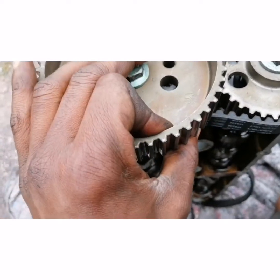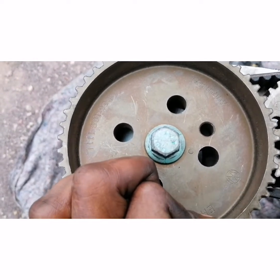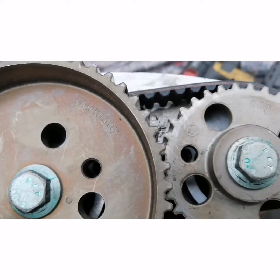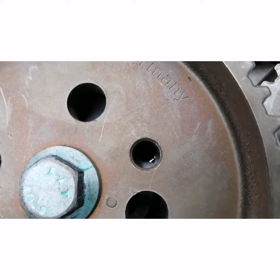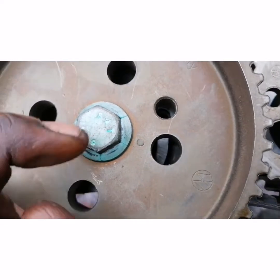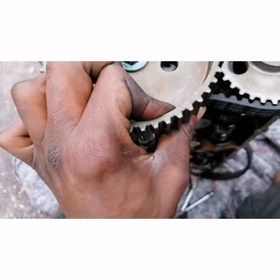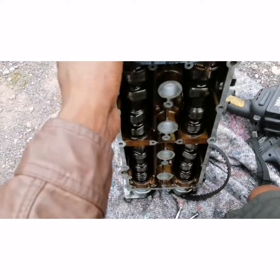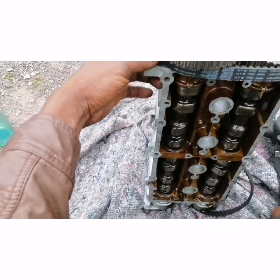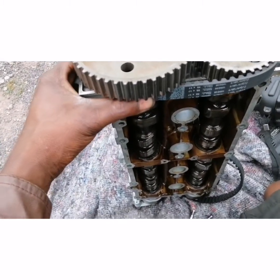Now I've put on my new timing belt. Inside here my holes are aligned — the first one is there and the second hole is here, though the camera isn't focusing well. You don't need to remove the camshafts or untie anything; just pull the old belt out and feed the new one in from the other side. When putting it on, hold it on the teeth on this side so it can't skip any teeth forward or backward.